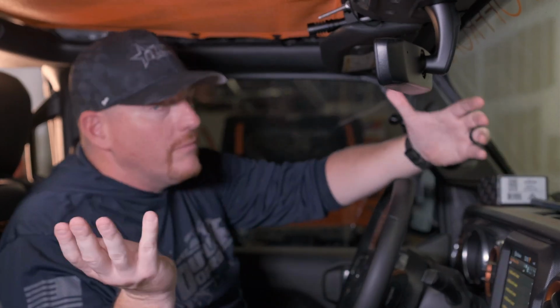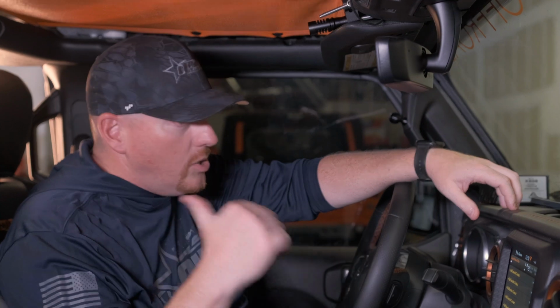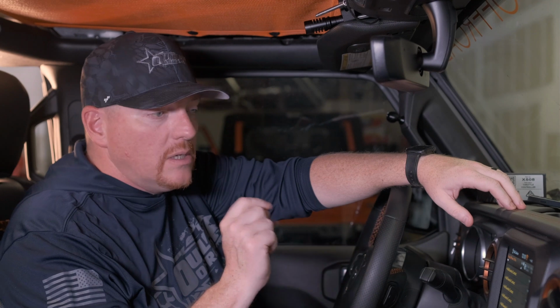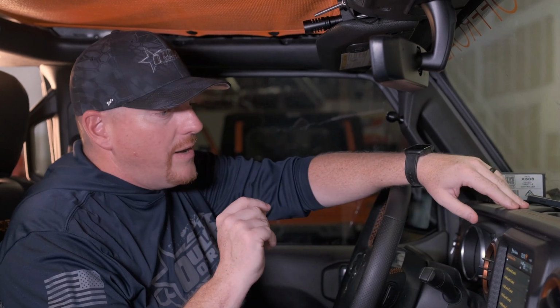And you can still do that, and that's fine. But if you don't want to do that, or for some reason you don't want somebody to know that you have it, whatever, you can actually, with the programming, take the box out, put it in your pocket, put it in your center console, walk off, leave, whatever. After it's installed, you actually would never need to have the box in there again if you don't need to. The Bluetooth receiver is in the module that goes on top of your throttle pedal, and that's hidden away. You don't have to see it. You don't have to think about it. It's just there. And if you want to change modes, pull up your phone, pop open the app, and change the modes.